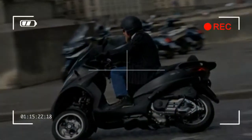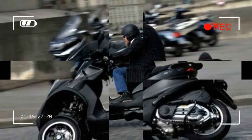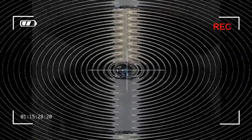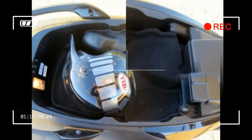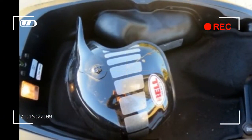With a little practice, you can flip the right thumb button inward just as you're coming to a stop, which clamps the caliper to the one-fourth of a brake-type disc which holds the MP3 upright. The people in the cars look at you with even greater suspicion. As soon as you twist the throttle to blast off, the lock releases, and in town, most of the time, you'd never really know you had two wheels up front. If you're rolling backwards, though, the upright lock won't release until you thumb the lever.